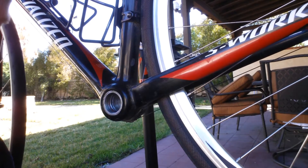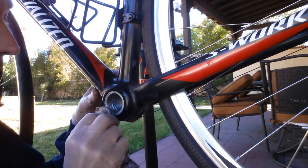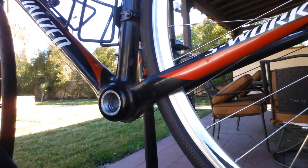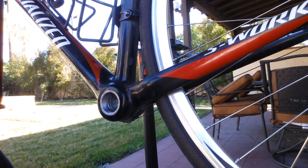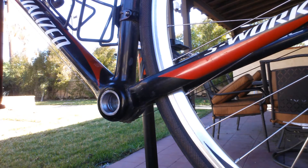This part is really important. After the bearing comes out, you've got to be sure to clean this area very well — not just for smooth operation and to get the grit out, but if there's a little grit in there, the crank will kind of creak or squeak while pedaling, which is totally annoying. The way to remedy that is to make sure all these contact points are clean and well greased when they go back together. That helps keep the squeaks and creaks down.